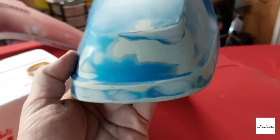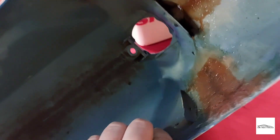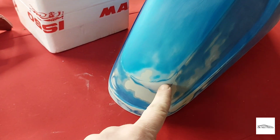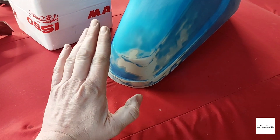The front mudguard is done. I've shaped the front as best I can because this was slightly flat where it'd been scuffed — this is now extremely smooth. This large crack which we had on the side — I've used some filler and you wouldn't even know there was once a crack. The fiberglass at the back has gone absolutely rock hard and I'm really happy with that. You won't see this anyway. I'm going to put this in some primer and hopefully with it all being one colour I'll be able to see the shape. It was a lot easier to repair than the original one with the hole — we're getting there.